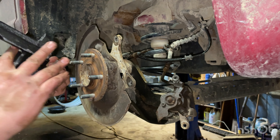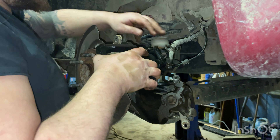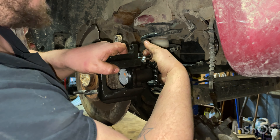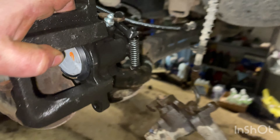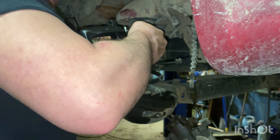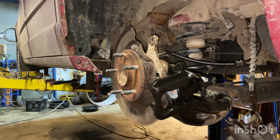All prepped up and back at it. Let's take our caliper and hook it into the e-brake cable — we're hooked in. Then we pull on the caliper and pull it over. See that little opening? It'll go through that cable slot — super easy. Then let it come back and clip into the little clippies on the e-brake cable. Boom — super easy, no special tools.